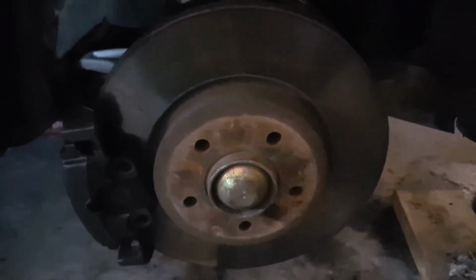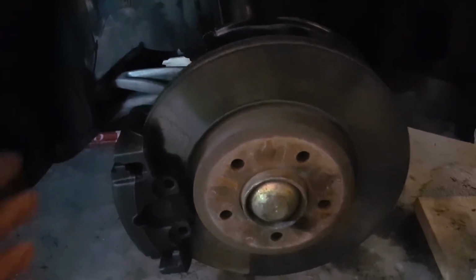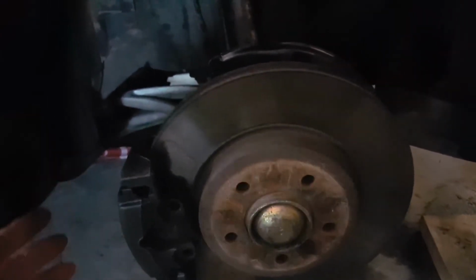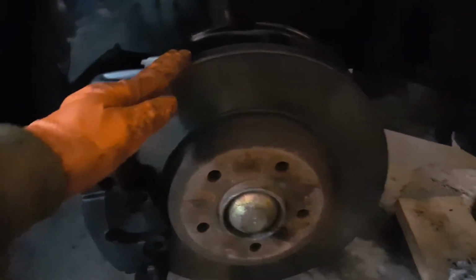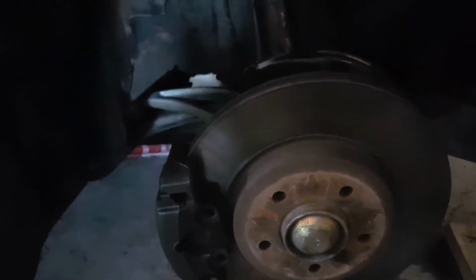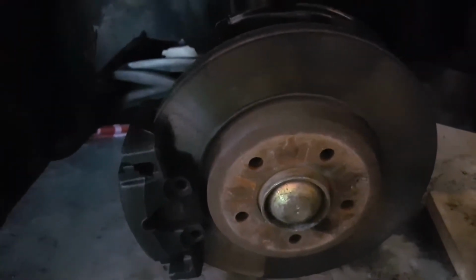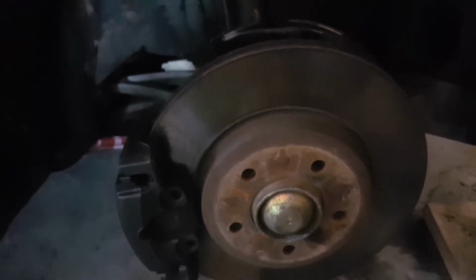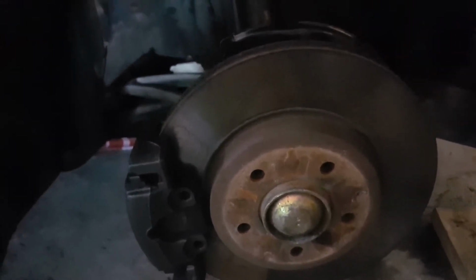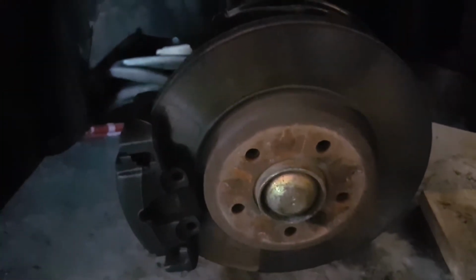Just now we turned the wheel with the tire and rim on. If you do the service and want to inspect whether the issue is resolved, you can also turn the disc by hand. Typically, a good brake system with a good slider pin and piston, you should be able to push it by hand. Certainly the gear has to be moved from the park position to N, R or D in order for this to move, which I already did earlier.